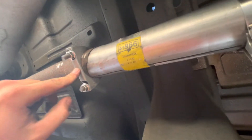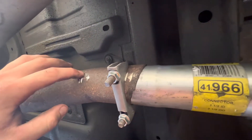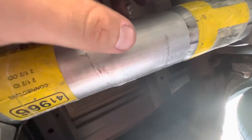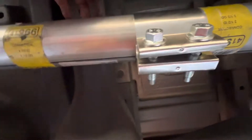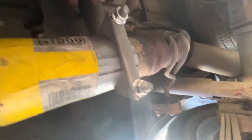Here are all the mistakes so you can learn from me. I need muffler tape to fix an air leak, and it needs some clamps. The pipe comes in 12-inch sections — I don't know if that's standard everywhere, but in Canada at Princess Auto. I used two ends of that, plus a reducer, and I left the flapper valve on, which I should have cut off. Anytime you're doing a muffler delete, make sure you cut that thing off.